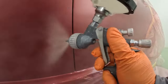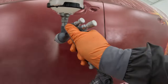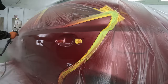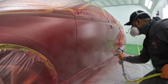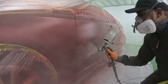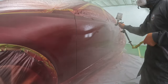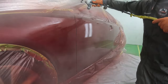On the clear coat, I dropped the pressure to 27 psi. The reason is I can get more use of the fluid going on there without working extra hard. The more pressure you have, the material comes out thinner but causes a lot more overspray. Too high a pressure can actually ruin your paint job or clear coat, just the same as it can ruin your paint or primer. Too low isn't good either – you have to find that in-between pressure.